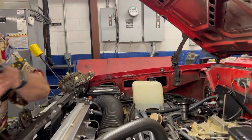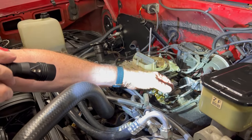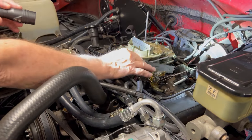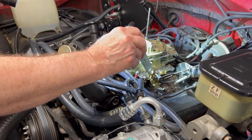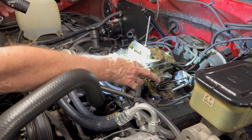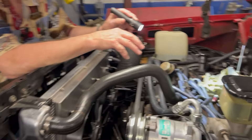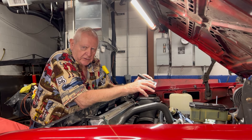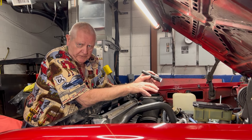So what do we do here? This right here is the shift cable — it's called the detent cable — and it's adjustable. When you push this button, you can take tension on or off of this cable as you are applying the gas with your pedal. You can see that it moves the detent cable. If you loosen or tighten it, it will change the shift pattern. Tightening it makes it shift quicker; loosening it makes it shift slower. That's what we did and actually got it where it shifts appropriately.